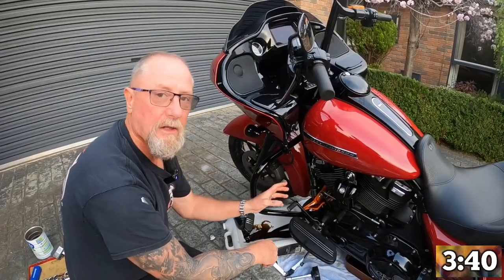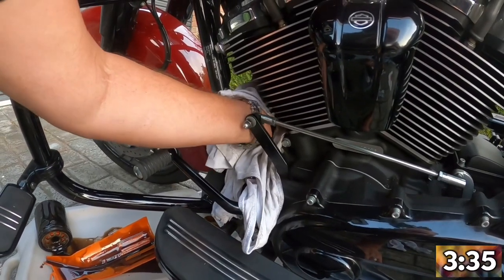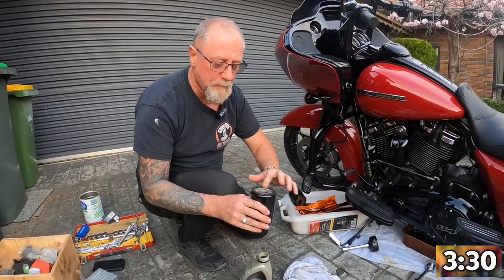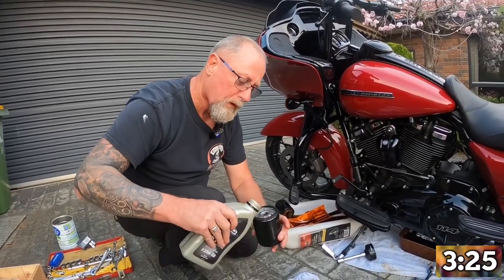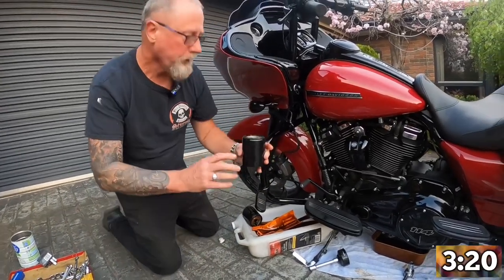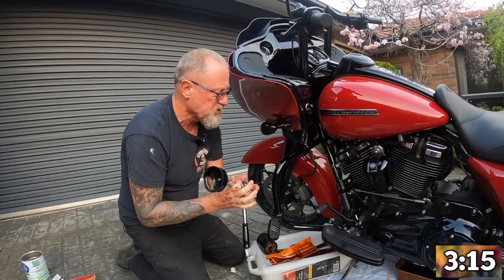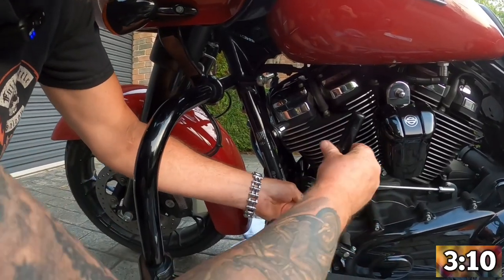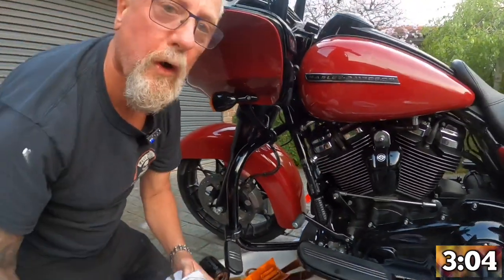Clean up in there and get the new oil filter ready. Before we put the new oil filter on — most importantly — put a little bit of oil around the lip, it helps with the seal. Then pour a little bit in, make it about half full, and now it's just a matter of putting it on. Once you get it to finger tight, you don't want to do these things too tight because it'll become a nightmare to get off next time. Half to three quarters of a turn — that's more than tight enough.